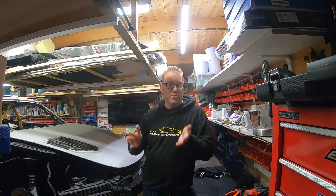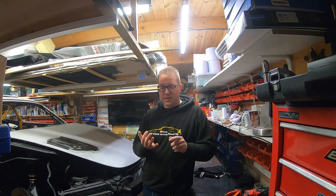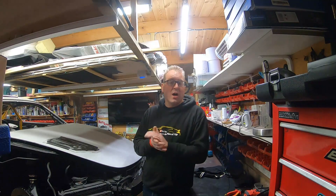Hello everybody, Paul79 here. I hope you're safe and well. Welcome to Part 8 of my home EV build, where I'm hoping to electrify a Porsche Boxster and also make it look like a GT3 RS. On this week's episode, I'm going to show you how I've constructed the battery packs — using Tesla modules, putting them in the boxes so they'll ultimately be mounted into the car. There's a lot involved: connecting the batteries with bus bars, the electronic side, and the coolant side, because the Tesla modules are water-cooled and you have to get involved with pipework.